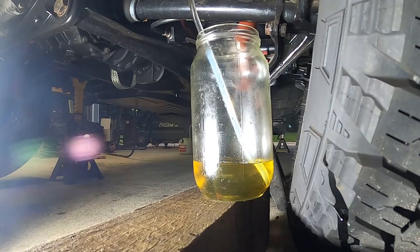On top of that, even though the car hasn't seen a gazillion miles, the fluid's been in there for a little while and it's due for a flush. This brake fluid stuff is hygroscopic, meaning it absorbs moisture — the humidity in the air gets in there because our caps are vented to the atmosphere, and eventually in an extreme case that can rust out the lines from the inside, which is very dangerous. So we're going to take care of two problems here by bleeding the brakes.